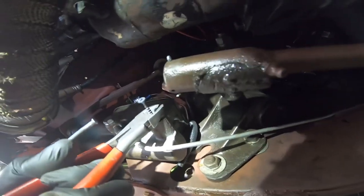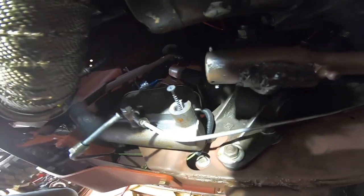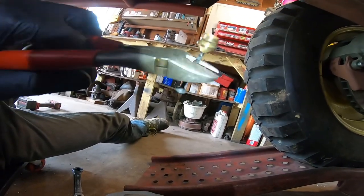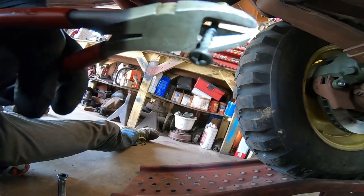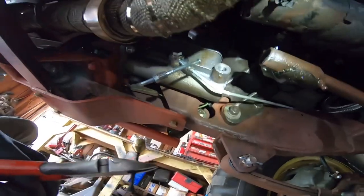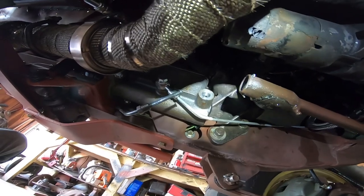Hopefully it works. I'm going to put the camera down and pop that out. It came out just like it did in the movies. You can see the little brass seat, and we should be able to reuse this because that hole really isn't in the sealing area. And I can indeed see a residual valve in there — it's a little rubber black piece.